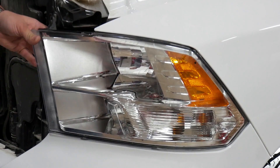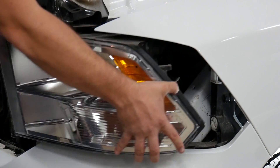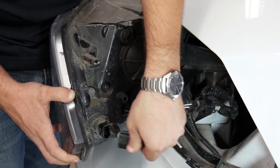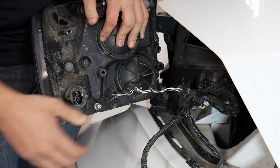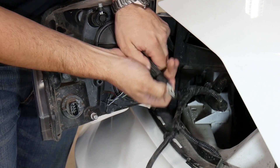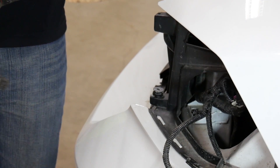We can finally pull the headlight out of the truck. Grab onto it with your left hand and just pull it toward you. Go ahead and pull the headlight toward you a little bit so you can see what you're working with. Push in on the tab for the turn signal and remove it, then pull out on this little gray connector here — press down and disconnect that. Now we can take the whole headlight out of the vehicle and over to the bench to install our headlights.